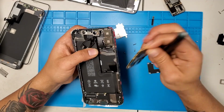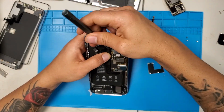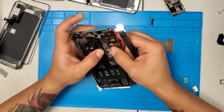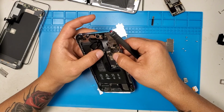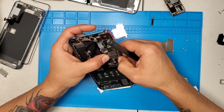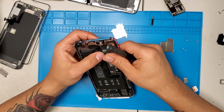Now the new board, we want to put it in place. Remove any other connections that are holding the board. Once it falls flat, we'll start with those 3 screws that we previously mentioned that hold the board. At the same time, you can start connecting the cables, because most of the work is done. Since the cables were previously used on this board, it'll be a lot easier. It'll just be clip-on.